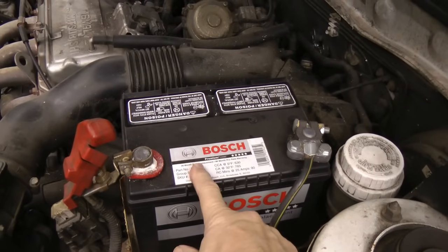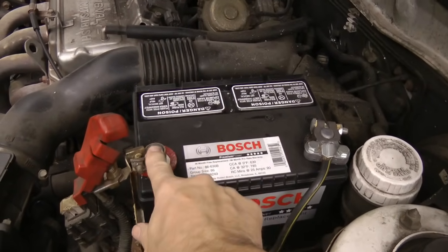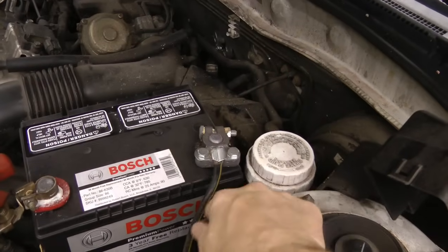Now realize that in your car, the battery supplies both positive power and negative ground power. And many times when weird things happen in your car, like you step on the brakes and the parking light comes on, you have a ground wire problem, which can often be hard to find.